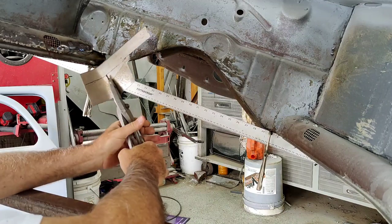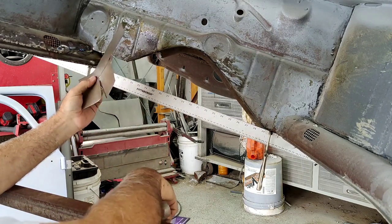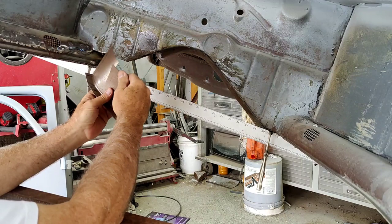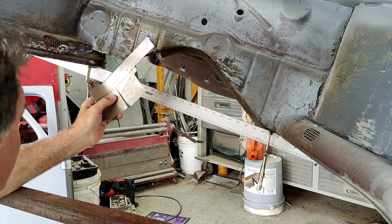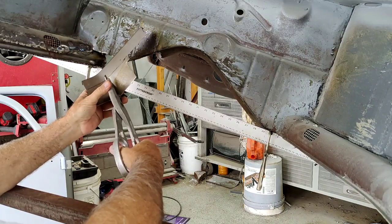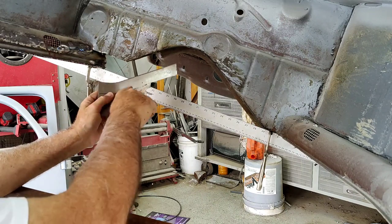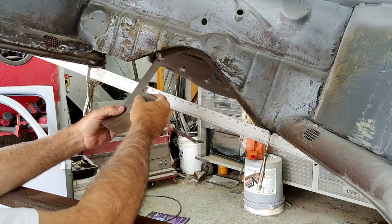All I do is just cut a slit right here. Okay. Now, I can bend this piece any direction I want to, right? This can be bent. Before it couldn't. What I'm going to do to make it a little easier on myself is I'm just going to pie cut this a little bit because it's going to overlap, all right? And that's fine, it doesn't matter. I'm going to pie cut a piece in here just so that it's easier for me when I can bend this part right here. So I'm going to take that real quick and bend it.